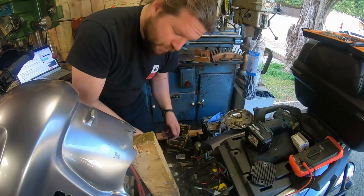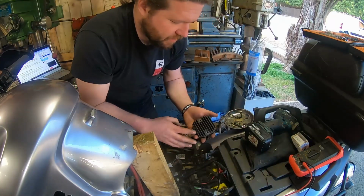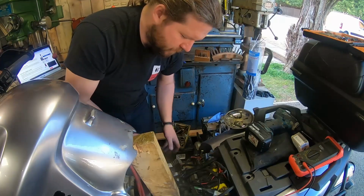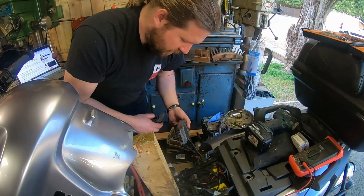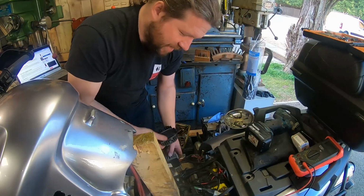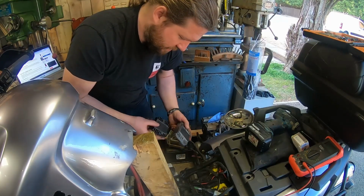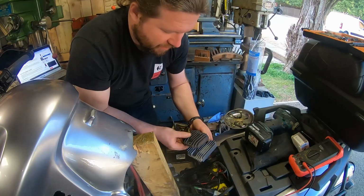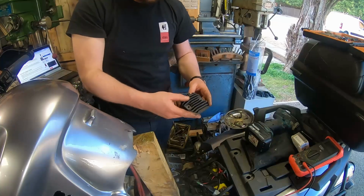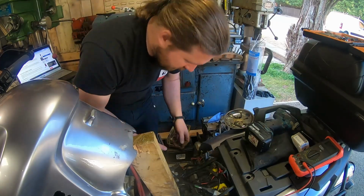Okay, on the same track? Perfect. I think that's failed. What I do have is one from a Yamaha Thundercat. It's very hard to work out what the actual load is on these, but the cabling is the exact same size on the loom that comes with this one. Physical size of the rectifier in there is the same as well, just the fins are bigger on this. So we could try that. I mean, it's Yamaha, so it's got to be better than an Italian one, isn't it?